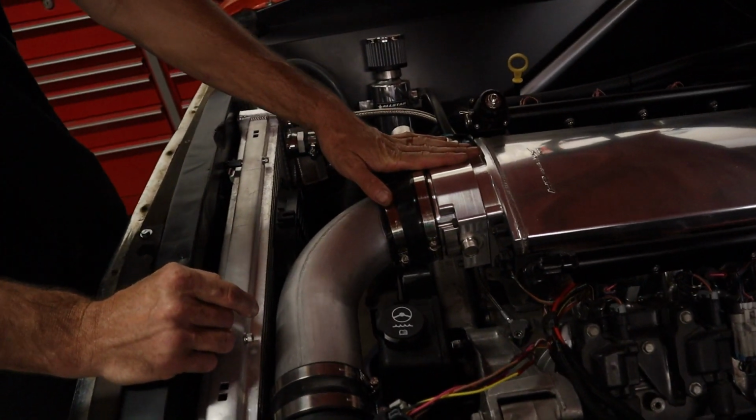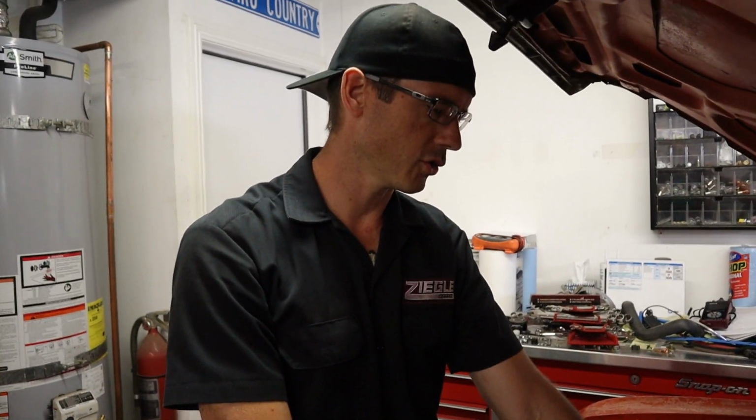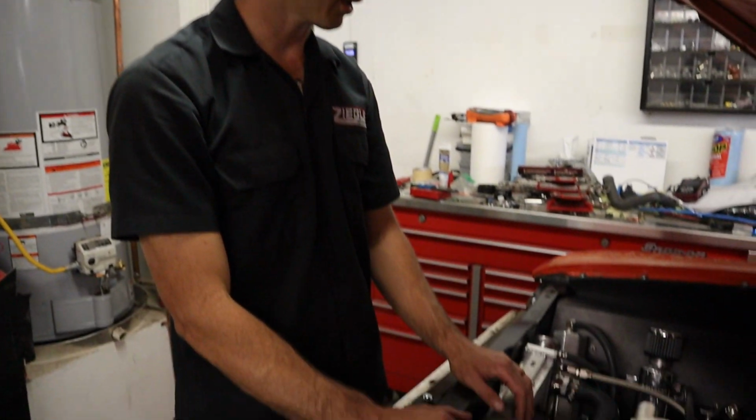And then the next hurdle we had was our little pedal here. It didn't have any communication. It was pinned wrong also. So we had to trace that down and get it in the right location for the PCM. You got to go off the schematic of the PCM, so we had to get that straightened out. That set us back a little bit, getting these two deals figured out, why they're not working.